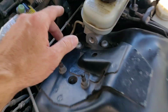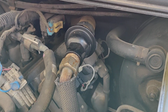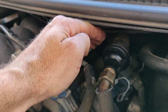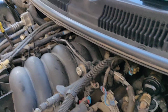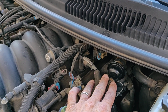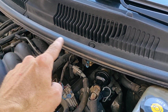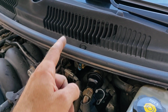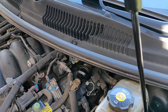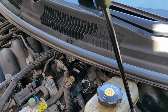Put that back on, and then you take off the rubber tube on either side of these. And then you should feel air pumping out of the rubber tube here and out of the rubber tube over there. If you do, then you know that your problem is most likely going to be these check valves. Okay, but if you don't feel any air coming out of those tubes, it's probably the air diverter valve or the solenoid back there up underneath the cowling, which I'm sure is all kinds of fun to get to. If it's even possible. It's probably possible.